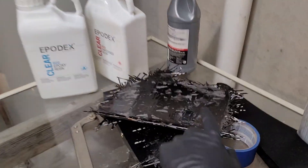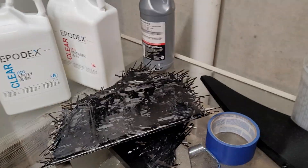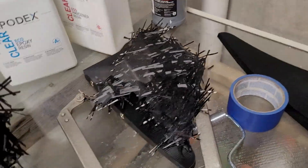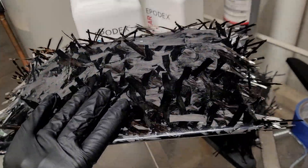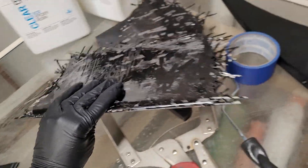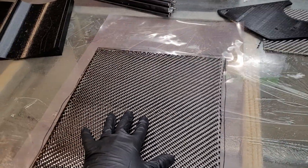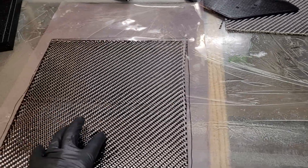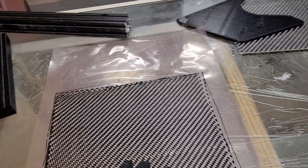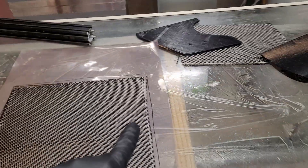We got our forged winglet and side mount all done. The side mount is reinforced on one side to keep dimensional stack-ups as well maintained as possible — just extra reinforcement. I'm really happy with how these came out. Using vacuum bagging material as a peel ply gives some ripples but a lot less than a drop cloth because it's stiffer. If I wanted to, I could sand and finish it and it'd look really nice — very little porosity and waviness. Now on to the standard twill weave side, same process but it'll actually be easier and more repeatable because the layer thickness is always two pieces of carbon thick, whereas the forged is completely random.